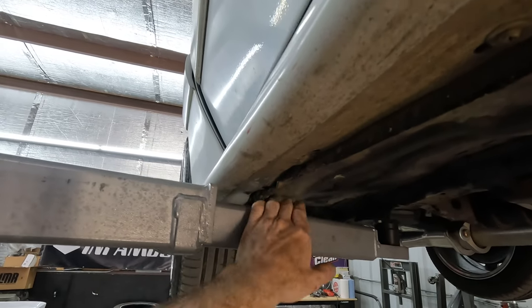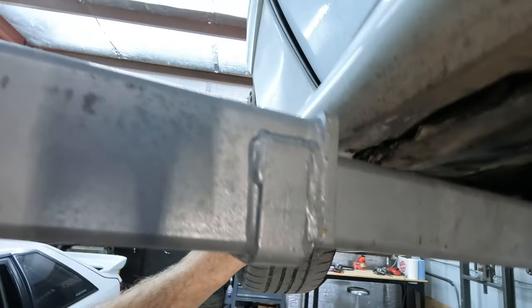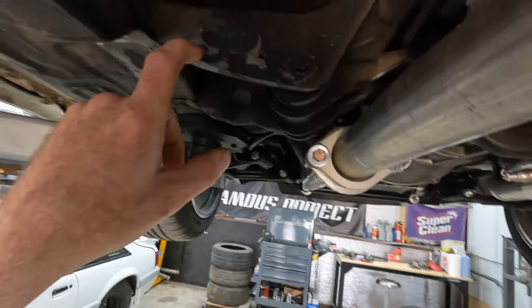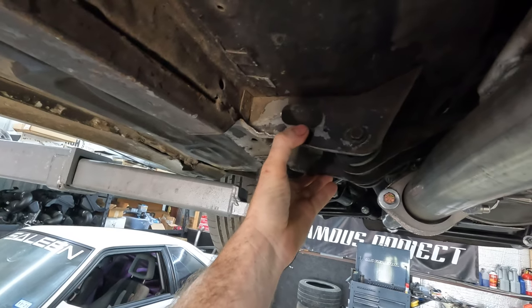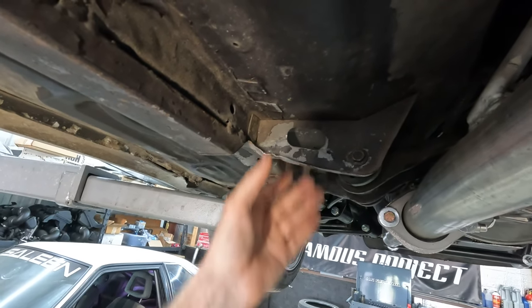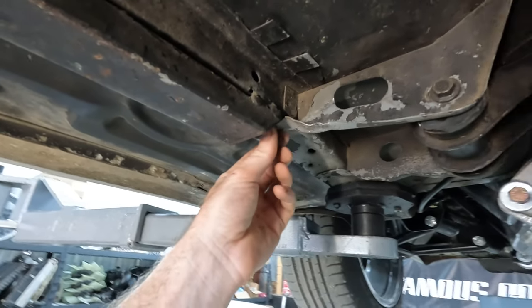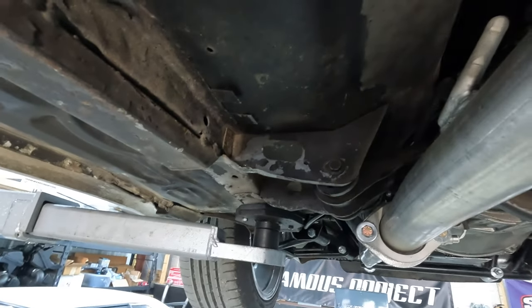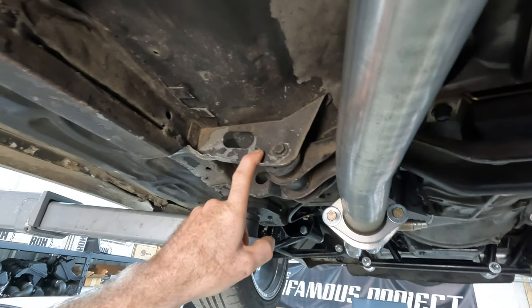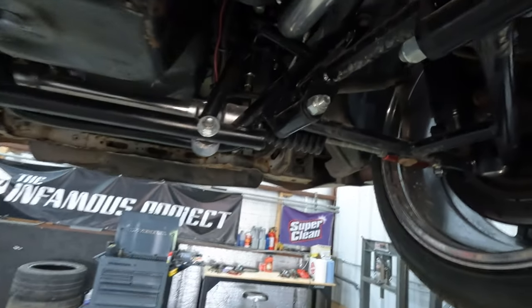Guys, never jack your car up on these pinch welds because that's just going to fold things and ultimately result in your fender getting kinked over. If we peek under here, yeah, we can see everything's twisted over quite a bit there. To get that done properly the side skirt needs to come off. It looked like someone jacked up on the transmission mount here — managed to straighten this out pretty good. David had a set of aftermarket transmission mount brackets, and for what it was worth in terms of straightening this out, we pretty much got it. It's going to get a tack weld right here just to make sure, because it looked like it kind of pulled away a little bit. Otherwise we would have had to pull all of the carpet out. I think this was the path of least resistance. We have an aluminum driveshaft, energy suspension transmission mount, all the tubular K-member and A-arm stuff. The last shop apparently didn't even have these tight, so David had to tighten those. That was part of his frustration.